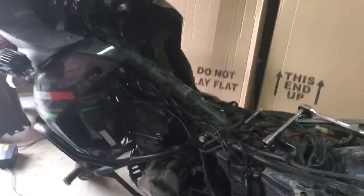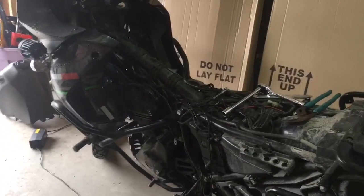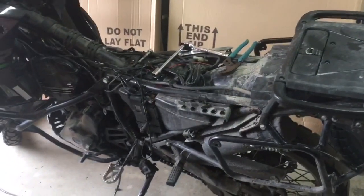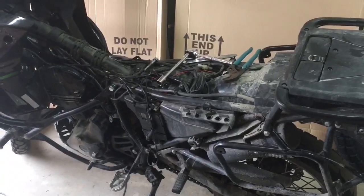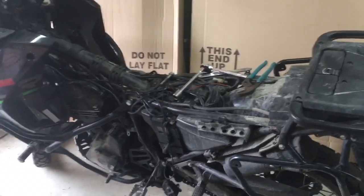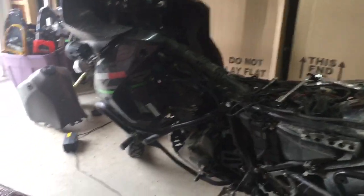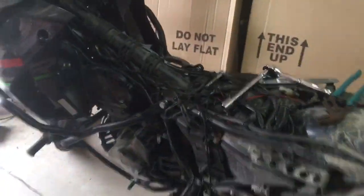Here's the choke cable in there. So I've been doing a few diagnostic tests — basically that's fancy speak for us KLR guys just turning it on and hitting the starter. It hasn't been starting. I got it to start and run for about 5 or 10 seconds before it died on me, and it's some sort of mixture problem. I don't know what it is. At this point I'm thinking it's running too rich, but I'm not sure. I took the air filter out temporarily just to make sure it wasn't clogged or making the mixture too rich that way.